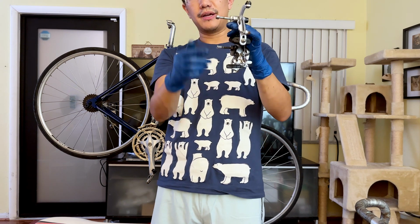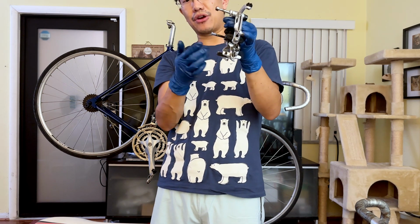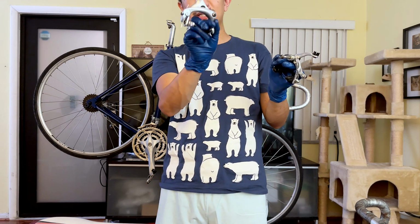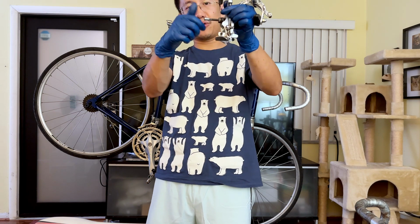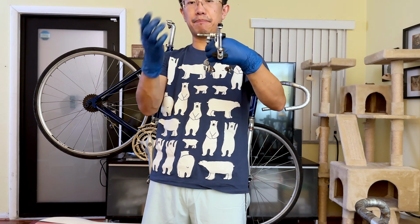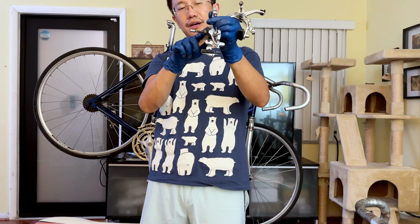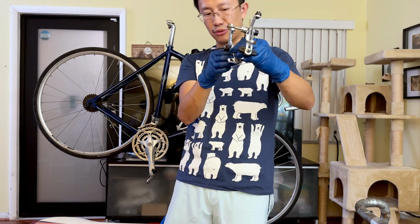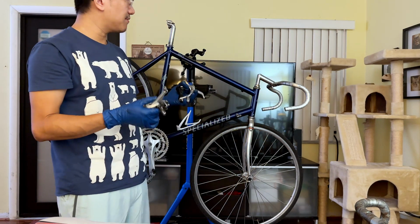You can go to a hardware store and get a traditional bolt that turns with a wrench instead of the recessed style. Recessed style you have to go on Amazon and buy. So really depends on what you need. If you're trying to get a dual pivot, a nice caliper brake for your old vintage bike, and your old vintage bike uses one of those external mounts, it's very easy. You just take off the external or the internal mount bolt and go to a hardware store, get one that fits over here in the correct size. Ace Hardware usually has an abundance of screw sizes available. One of them is gonna be like this. You can mount your new brake to the old frame with the new bolt. Okay, so that's the only thing you need to take special note of. Otherwise, if you're using modern components, most of them are going to be very, very compatible, okay?